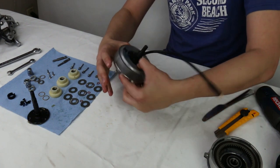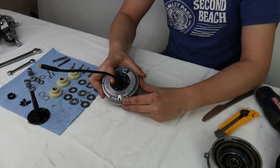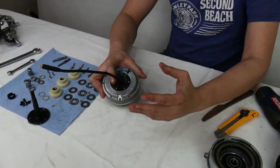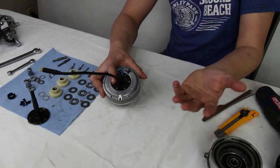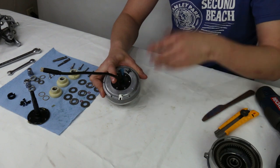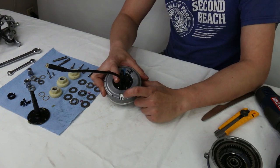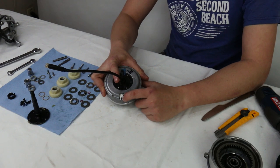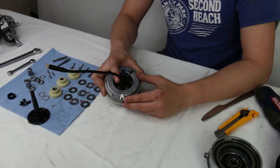This is also an opportune time to show another cool feature of this motor: its hall sensor speed pickup. One common drawback of gear-reduced motors is that they don't work with hall sensor-informed speedometers because the rotor is not always coupled to the wheel. But with this standalone hall sensor speed pickup, you can use the Cycle Analyst to display your speed even with a geared motor.